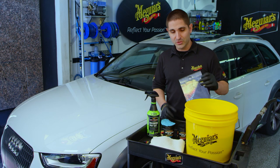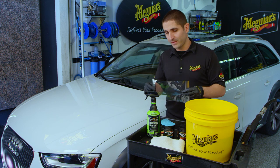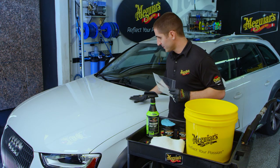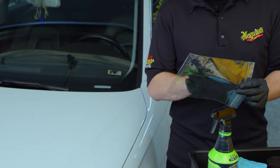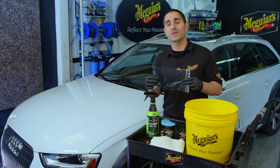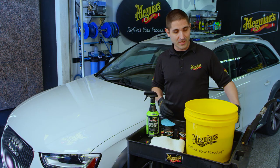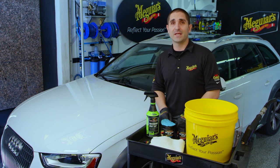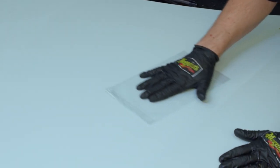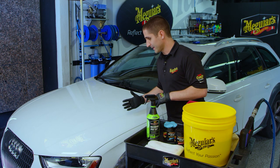You'll also want to check your work. Take a piece of plastic like a lunch bag or cellophane-type plastic, and use either a quick detailer or some of the iron-removing spray clay to spray on the surface and make it nice and wet. Then place your hand in the bag or behind the plastic and rub it on the surface. Believe it or not, you will actually magnify the bumps and feel them if there's still something there. This allows you to double-check that you've gotten everything before moving on to the next step of compounding, polishing, and/or putting on a wax sealant or coating. In this case, it's nice and smooth, so I know I've removed all the contamination and can move on.